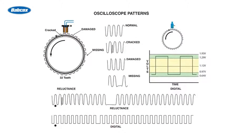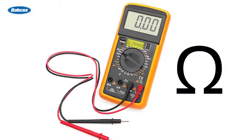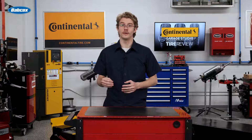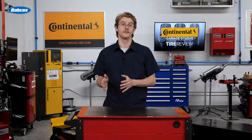For electrical circuit codes, verify the sensor's resistive value in the 1000 to 2500 ohm range. Inspect the wiring too, and measure the output voltage or the presence of a bias voltage to confirm the operation of the module.